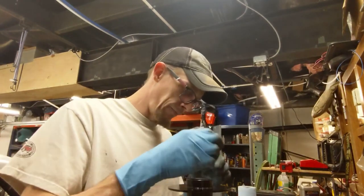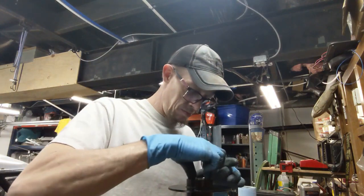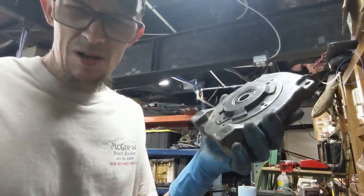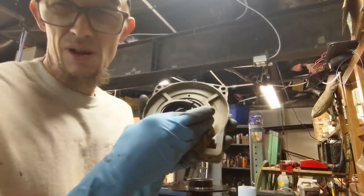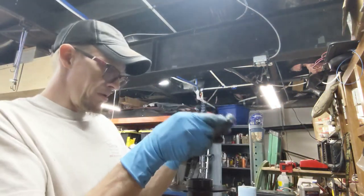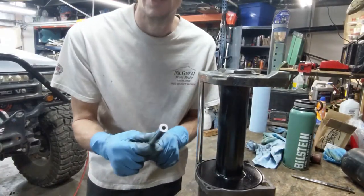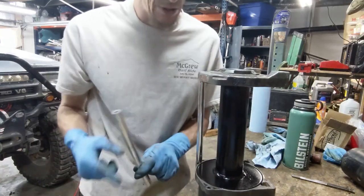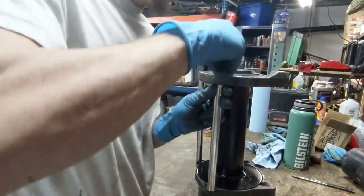Drum back on. Brake down in there. Now we're to this part - basically just the other side, same action. The collar goes in there, it's located by that slot. And then this guy goes on there. These tie rods are fairly straightforward - they don't come threaded, they just give you these self-tappers. I self-tapped these already so I didn't bore you with that, but they tap easily by hand so it wasn't a huge deal anyway. This is a quarter inch Allen.